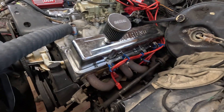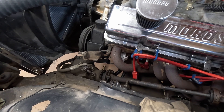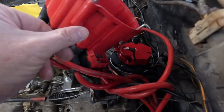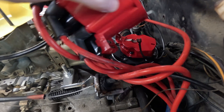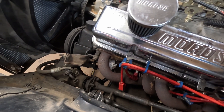I took a piece of paper towel and literally crammed it in the hole — stuffed in tight. You then turn the engine over. Theoretically, if the exhaust valve is open there won't be enough compression to push it out. I used the key; the ignition is disconnected — make sure it's not going to short, and make sure nothing's interfering with your distributor or rotor turning. I bumped it over and this thing literally popped out — it shot out, it was pretty funny. So now I know it was on the compression stroke.